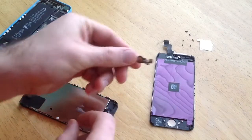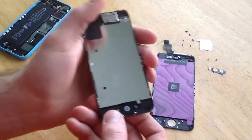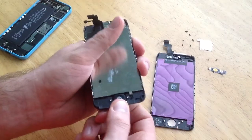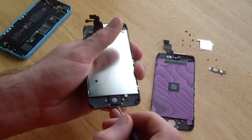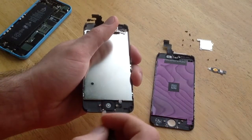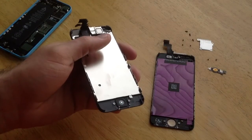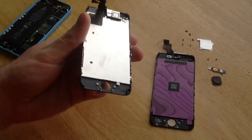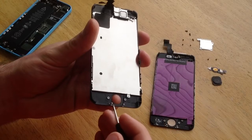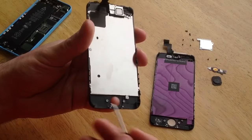And that is your home button — you will need that, so lay it off to the side. If your kit did not come with a home button, most of them usually don't. Go ahead and use something sharp — there is a sticky sticker type thing around the edge — and pry that up to get it out so you can reuse this button. The way I do that is I'll push from the bottom and use a flat head screwdriver to prop up one side, and once you get it unglued partway it usually comes up pretty easy.